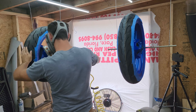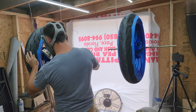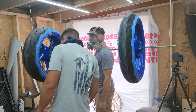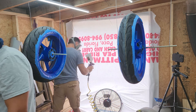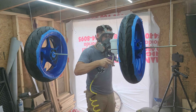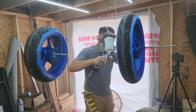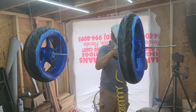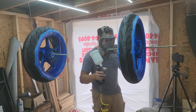After the tack coat is sprayed on, I just went back quickly and did my first full coat, making sure to wet out the surfaces as I spray them. Rims are an interesting one to spray as there are very few flat areas, so you have to be careful not to cause runs — which thankfully I managed to avoid. I ended up spraying 3 coats to build up a nice thick coat of clear to protect the surfaces, especially since rims tend to take quite a beating.